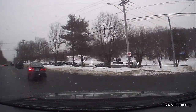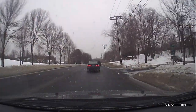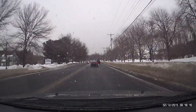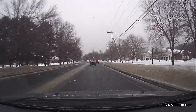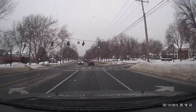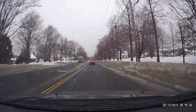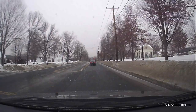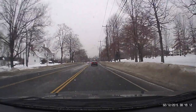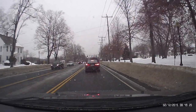Here we have me just driving around town, testing out the camera on its 720p setting. Prior to this I was playing around with higher resolutions — didn't seem to work too well. My guess is the sensor is not actually able to do 1080p, so what it does is just stretch the image, and you get noticeable pixelation. It doesn't look as clear as the 720p resolution. Lower resolutions work fine. As you can see during daytime it is very good — you can see everything. If you needed to in a pinch, if you get close enough you can see the license plate of the driver in front of you. Daytime — I definitely give it a thumbs up. Let's see what it does at night.